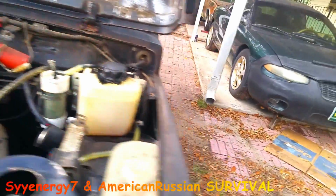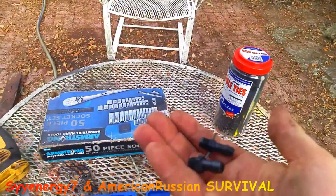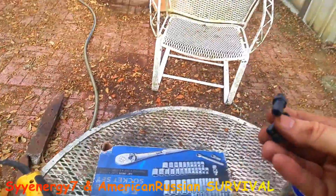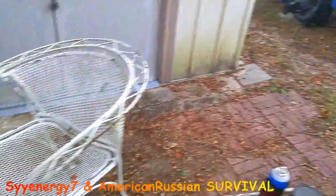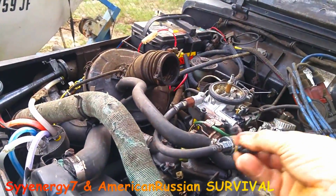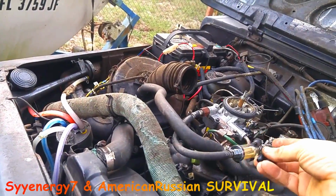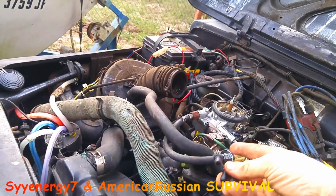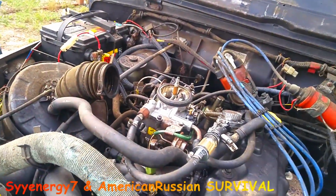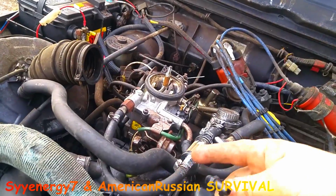See these things here? These are the fittings that screw in. There's various sizes. I use some Teflon tape. So they screw into there. So you got an inlet and an outlet, so you can adapt different size hoses with this, if you have different metal fittings with hoses. It's not a perfect setup, but it's not going to fail. In other words, this hose is the right size for this fitting, and then this hose is the right size for this fitting.